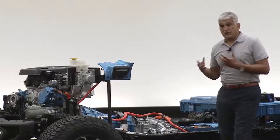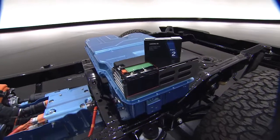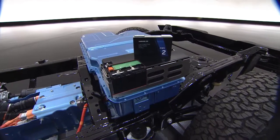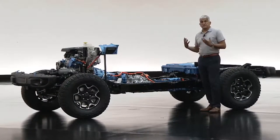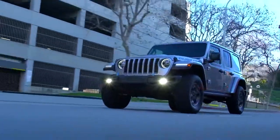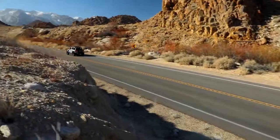To power all this, we put on board a 400 volt battery pack. Energy comes from 96 lithium-ion NMC chemistry cells, and this battery pack is mounted underneath the second row seat to protect it — not underneath the vehicle where some other battery packs are mounted. We wanted the Jeep to be a Jeep.